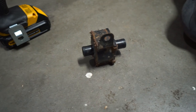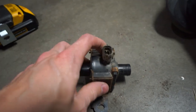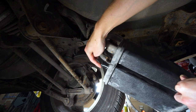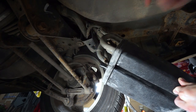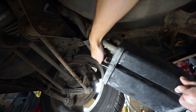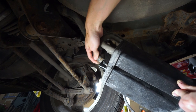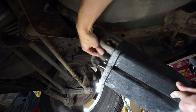That was easier than I was expecting - the hoses came off just with some pliers, super easy. And then the plug was the hardest thing; you just have to wiggle it out. So we're ready to throw this away and install the new one. While we're down there, we're going to do one other thing that might also help with the filling issue - and it's these two hoses. The front two connections, not the upper one, the lower and the little tiny one. It's raining charcoal, so if your canister is a little wonky, it could also be because there is a bunch of charcoal in the hoses. So I just went ahead, grabbed some pliers and pulled these off.